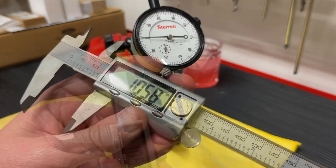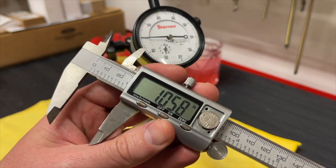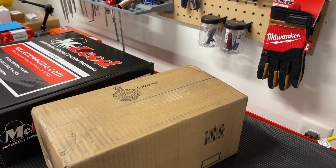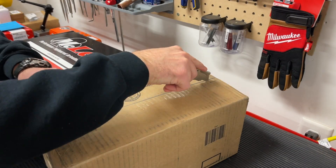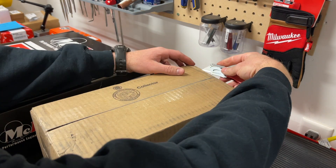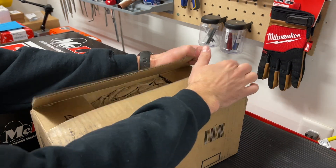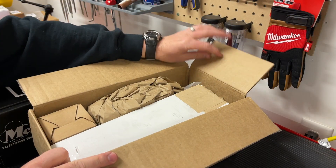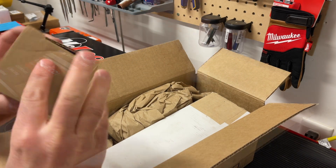I did my best to try to track it down, but I didn't like the other ones I'd find because they would use the exact same model number with other letters or numbers in front to make it sound like it's the Tremec one. I had to dig deep to find out whether it was or was not the real Tremec shaft, and a lot of the time you're looking at what metal it's made of. The Tremec ones were made of 9310 steel, and the newer ones are 8620 — you can almost tell by how they look, as the newer 8620 metal is more of a silver color. But everywhere I looked, they came up with the same white box.